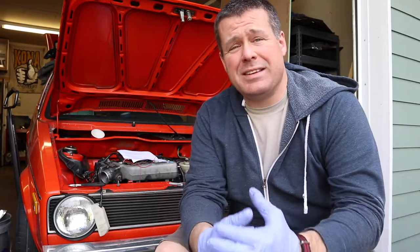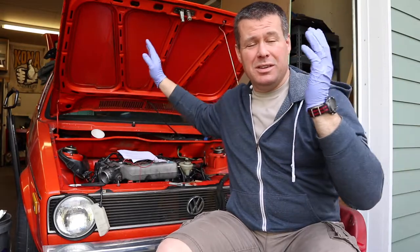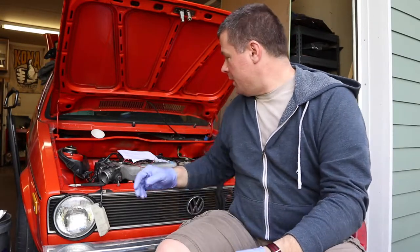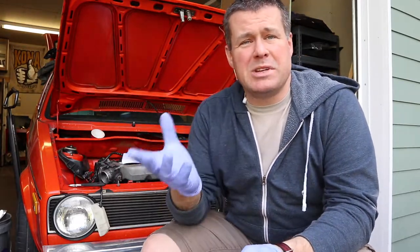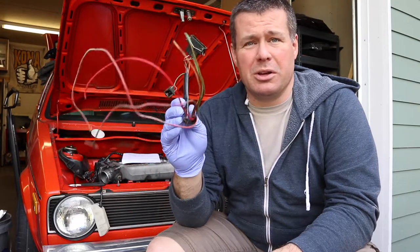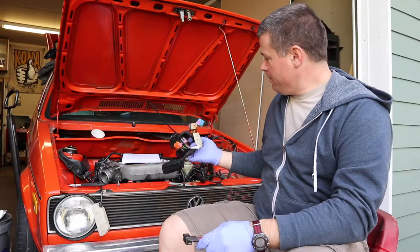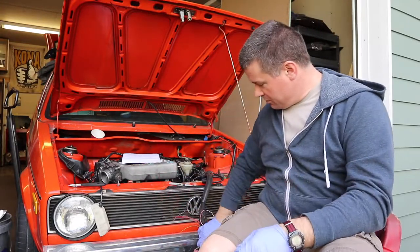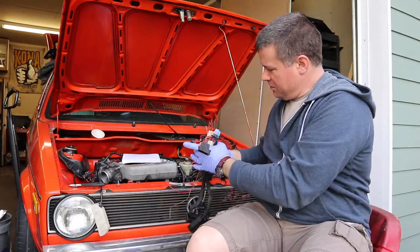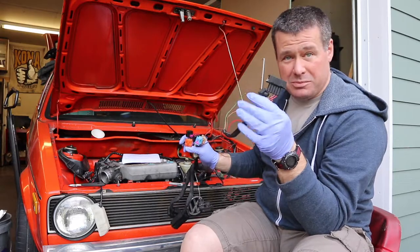I figured this week I would try to get the engine harness wired in. So since we put a cabriolet harness in this car from a 90-ish cabriolet with the CE2 wiring, the engine compartment harness that comes out to do the engine management has this plug. This is from the Digifant series wiring that was in the car, and we need to incorporate the AEB wiring for the Audi 1.8T. Basically these five plugs right here are going to end up going into this plug.